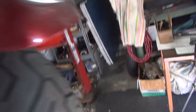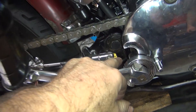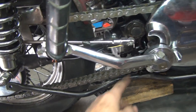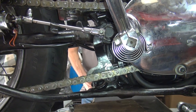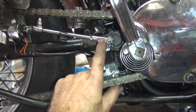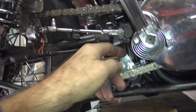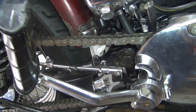You've got to come back and readjust the brake back here to actually adjust the shoes. Make sure when you stand on the brake hard it doesn't bottom out — you've still got a finger and a half of clearance at full pressure. When this lever gets too far back, the leverage ratio gets all screwed up. Ideally you want the brake to work just over center. In the real world, you want about an inch of clearance under here — when it starts getting up to an inch and a quarter, a lot of times it'll hit up under the cover and the brake won't work anymore. It gets a hard stop.